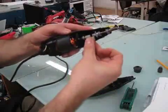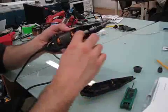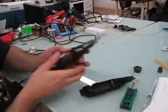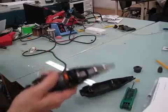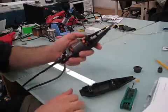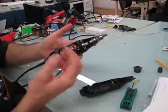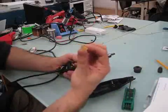Normally this goes here to connect the motor with the drive shaft. You might be wondering, why not just have the motor connected directly to the drive shaft? Well, this piece of coupling actually gives you some protection. Say you're drilling something that's too rough — you're trying to drill some steel, or maybe you're drilling something soft. What this does is it acts like a fuse. It's the part that wears out first, so it actually protects the motor from overheating and fire and wearing out by wearing out this little shaft coupler instead.